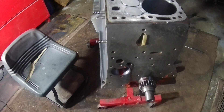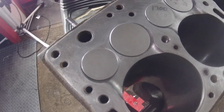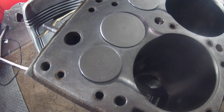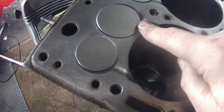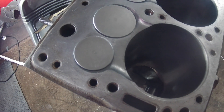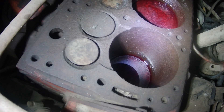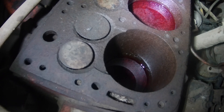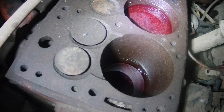I've got the crank in. I want to show you a close-up of this port job — what he did — so I'm going to walk over to my '54 here in a second and show you what the '54 looks like, which is similar to what my '51 is. I'll show you what the difference is — just take notice of all this material that he took away. This is the '54 308, which from what I understand was actually milled out a little bit more than the '51s were. They had already kind of gotten the word that if you open this area out you can get better performance — that's what I remember reading somewhere.